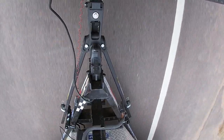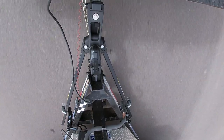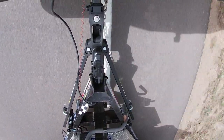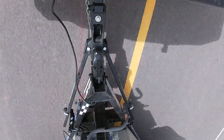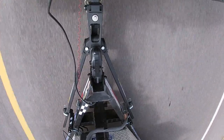We're testing out the sway control and you can't make this thing sway. Those spring arms are nice and tight. They slide through the trailer tongue brackets, and that little L piece grabs it as it tries to sway, just like around a corner. It's greasable and all heavy duty, with very good control on a trailer. This is actually rated at 15,000 pounds with 1,500 pounds of tongue weight — that's your 10% tongue weight. I've got the scale, I can see everything.